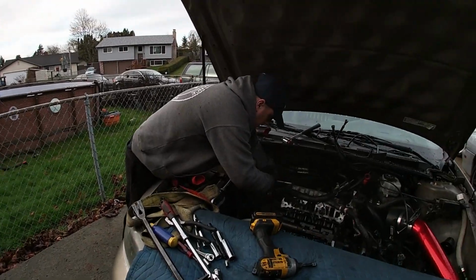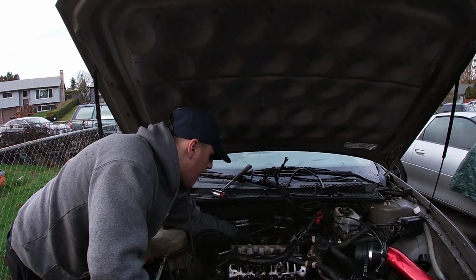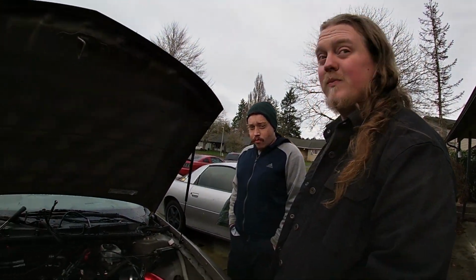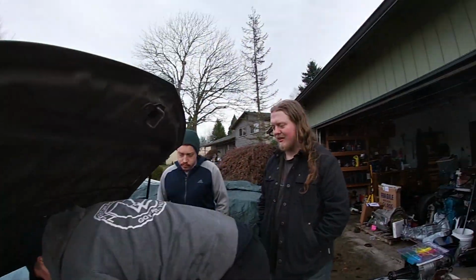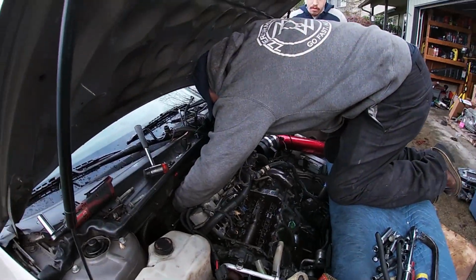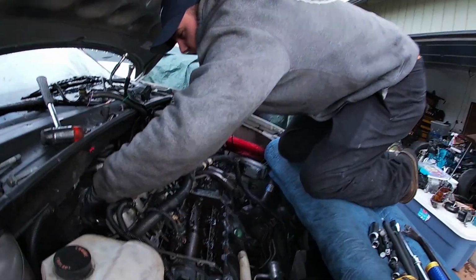What was the transmission company called? Triple Edge, yeah. They said that the 3.29s wouldn't affect gas mileage very much, which is true. I mean, you're not changing very drastically, but it'll help. I was telling him he should get a torque converter while it's out. Ooh, a big stall. Well, not a big stall. You can get a 2500 stall or 3000. $4,000. Yeah, just $4,000. The ZZP one's only 2,500, which is only a little bit better than the stock converter.